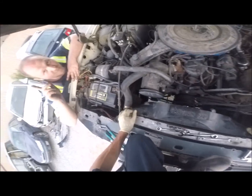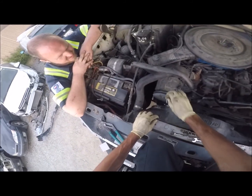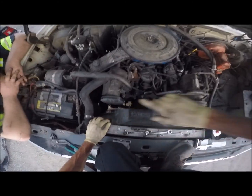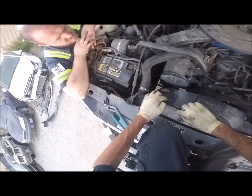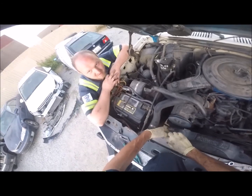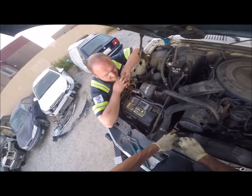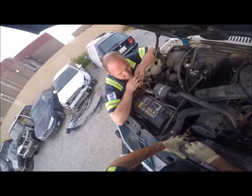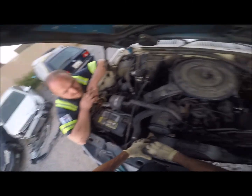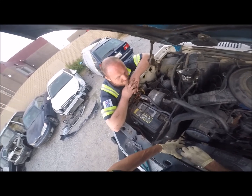Yeah. You don't have to have it. Well, you have to have it legally, but... In California. Yeah, in California, all this stuff has to be there. It really doesn't do anything for your truck, but it has to be there. Looks like all these vacuum lines and these breathers have to be there. So if you like them little Edelbrock breather caps that you put on and vent open, well, those are illegal in California because it can't vent to the atmosphere. That's why it has that tube right there that goes right back to the air cleaner, and it sucks that in and reburns it. So theoretically, you are burning oil. Normally, you're burning oil vapor. That's to trap the oil vapor, suck it back in, and burn that off so it doesn't wind up in the atmosphere.